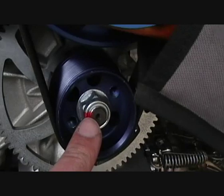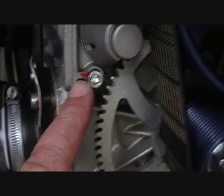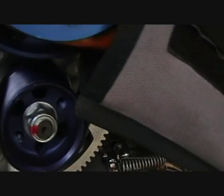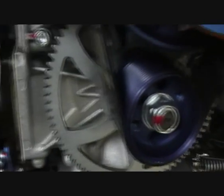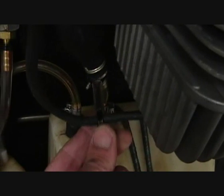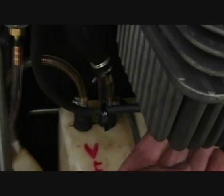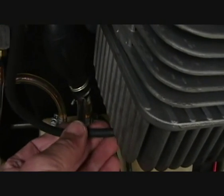Another little tip: I mark all the nuts and bolts with a bit of nail varnish, and that way when you do a pre-flight visual inspection you can see if anything has vibrated loose. Also, I've cable-tied the spark plug lead back because if the plug cap does happen to come off I don't want it destroying a 200 pound prop.